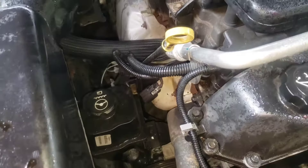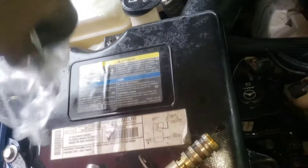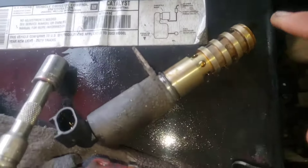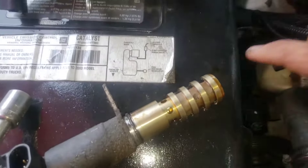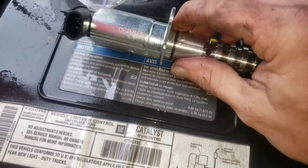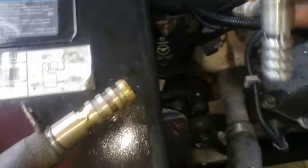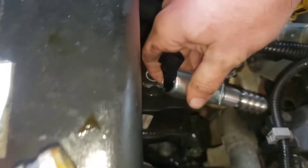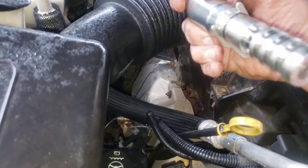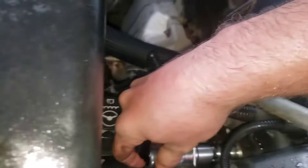You can take your finger and just take a little bit of that oil on the end of the old one — just kind of run it around the seal. All you're doing is lubricating it a little bit to make it easier going back in and if it has to come back out. Now I'm going to take this new one, make sure there's no debris on it, because you don't want that in your engine.